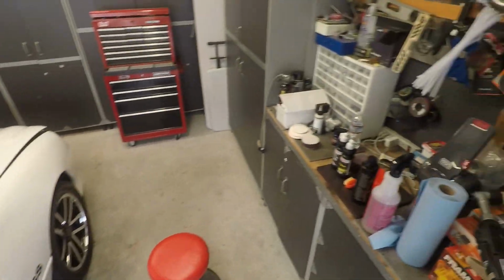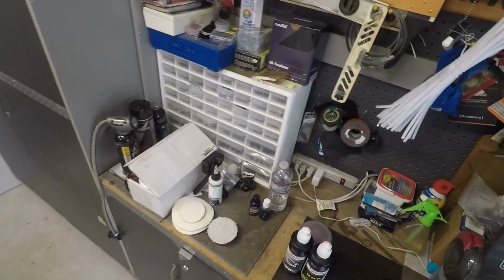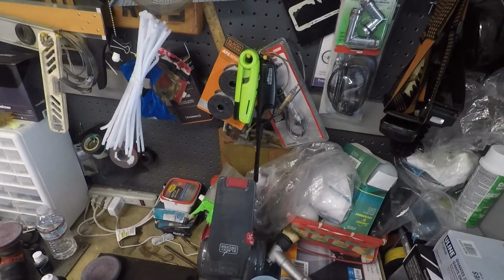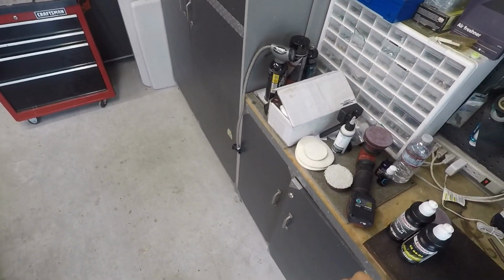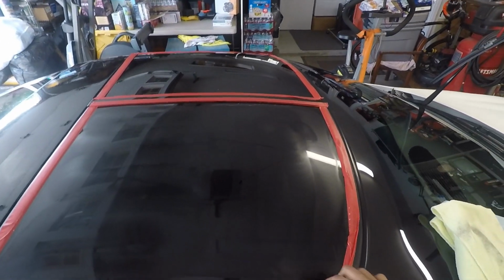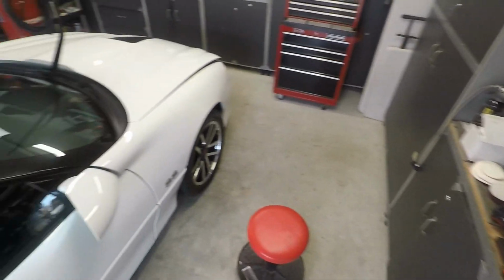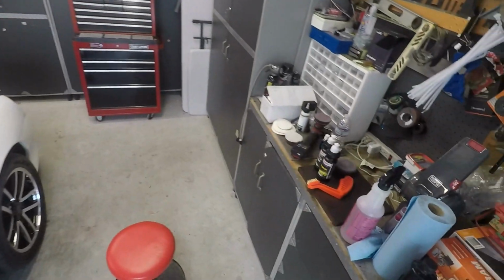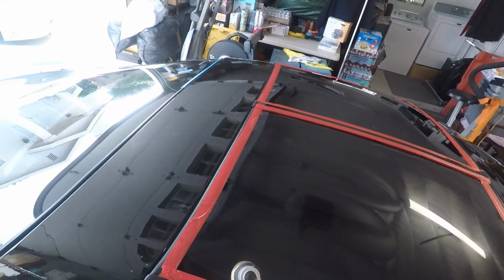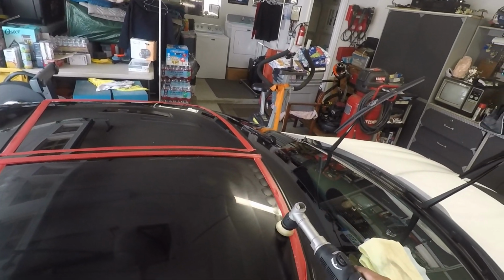Okay, so that was 8 section passes. Again, like I said, your pad's going to load up, so just have yourself either a brush or your compressor turned on. Now I actually have the Nano to get into the smaller areas. If you don't have a Nano or anything like that, just take the pad off and use your fingers. I don't feel like working that hard, so I'll just put product onto this guy, working into the pad. Now these pads I'm using here are some Lake Country Force pads. This is the polishing pad, because I didn't like them, they got downgraded to glass pads.